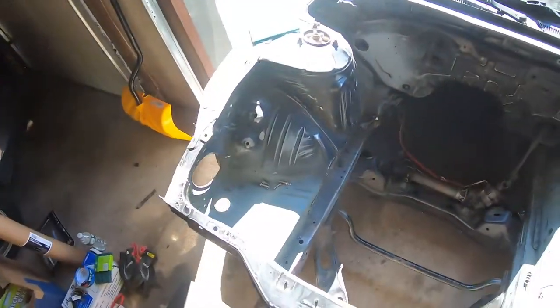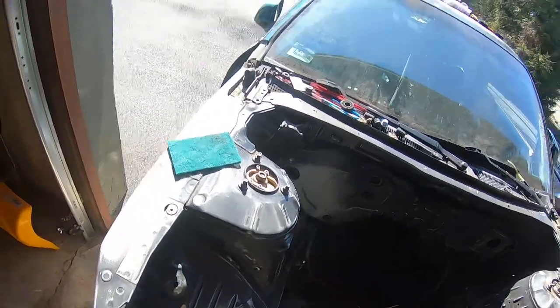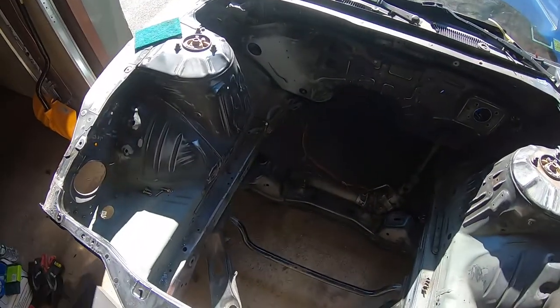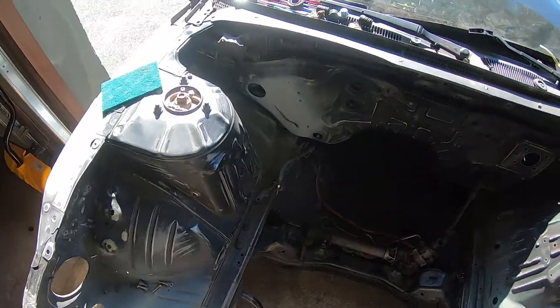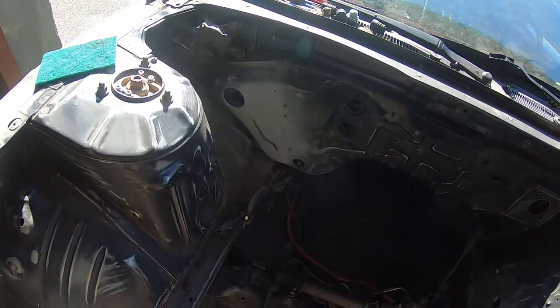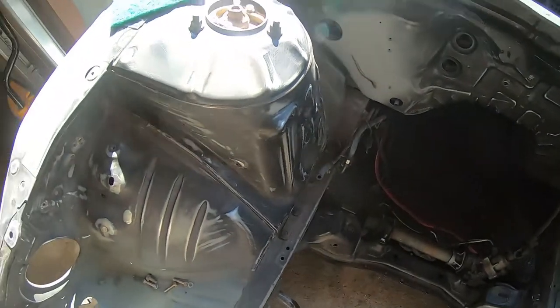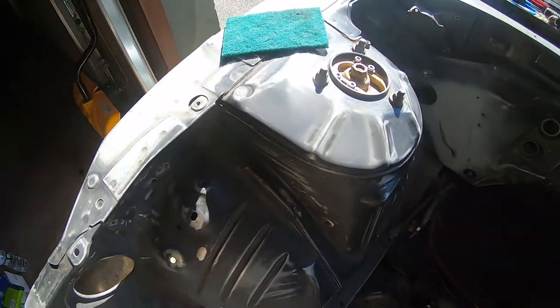What's going on guys, we're back again today. I'm gonna get some progress done on the engine bay. I have scotch-brite green pads, a red pad, and some sandpaper. I'm just gonna scuff up the whole engine bay as best I can. I ended up priming it but had a drip, so I have to sand that down again - not a big deal. Overall the repair looks pretty good, so I'm just gonna go over the whole engine bay with this scotch-brite to scuff it up.